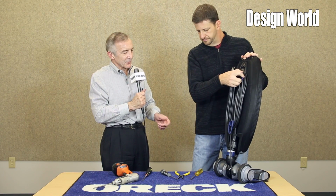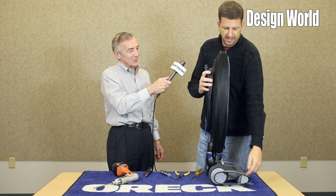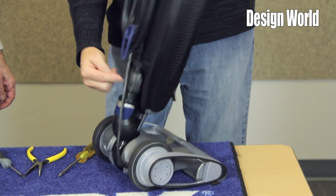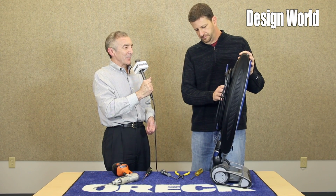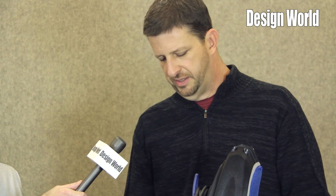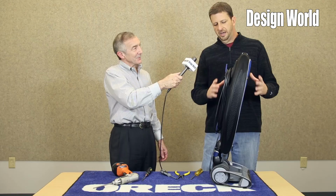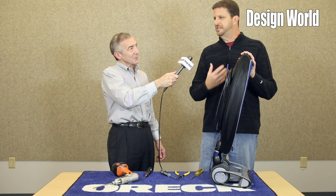Just so our viewers are clear on that, basically the blower blows air into the bag, correct? Correct. Basically your air path would be: it sucks air in here, air and debris come in here, go through your fan package, up through this dirt tube on the back, and into your bag. And that's different from vacuum cleaners where you can see the dirt going into the canister, right? Correct. This is a bagged vacuum cleaner. We call it a dirty air unit because the dirt passes straight through the fan. Most other vacuum cleaners are clean air units, which typically require a much longer debris path, leading to higher incidences of clogs, as well as basic losses across the system. So you have to drive the motor harder, which means you use more energy.